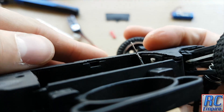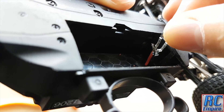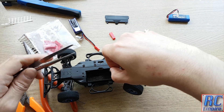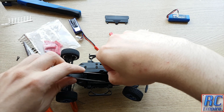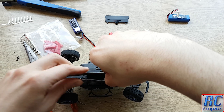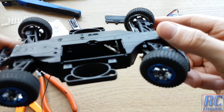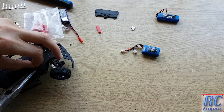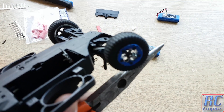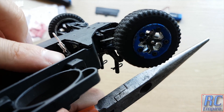I've already placed the terminal on the red wire, and now we will do the black one. I've held the terminal in place with my right hand, and with these precision tweezers I've just clamped down the bottom part of the terminal onto the plastic insulation, just slightly for now so that it stays in place. Then with some needle nose pliers or something a little more heavy duty, you can tighten down the clamps on both parts of the terminal onto the wire and the insulation.